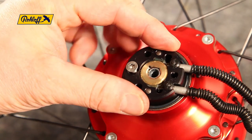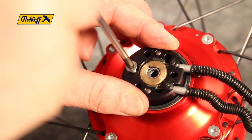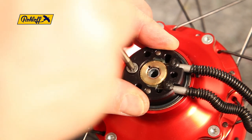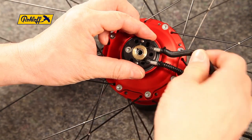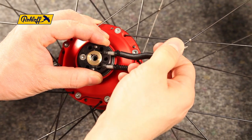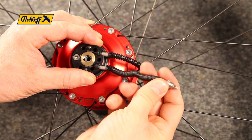Please note the stainless steel axle ring screw is shorter than the axle plate screws. Check the smooth function of the new hub cable by pulling each cable end alternately through all 13 indexed clicks. In each end position, the cable lengths should be the same.